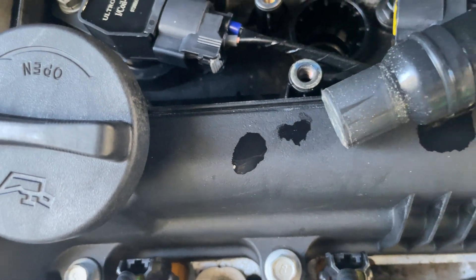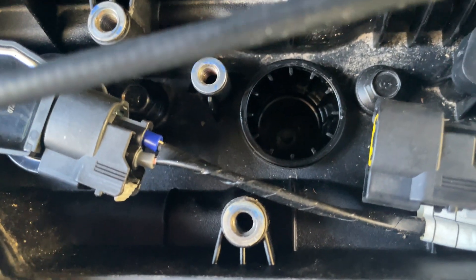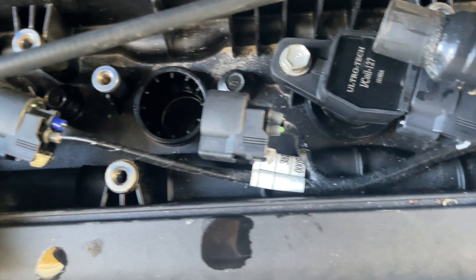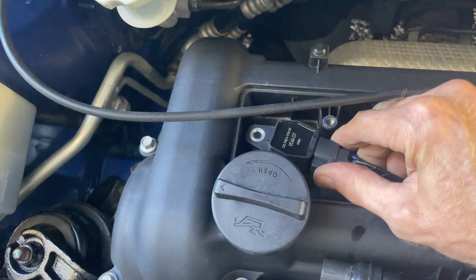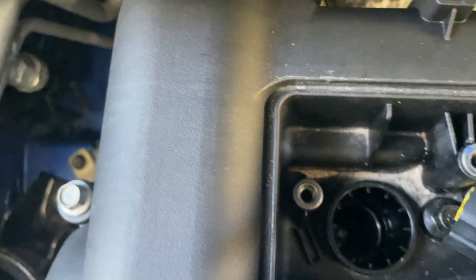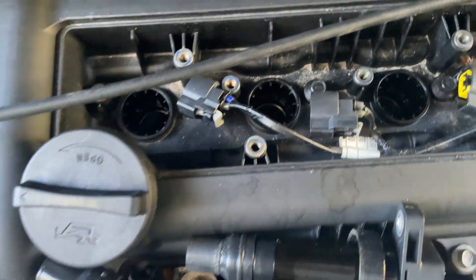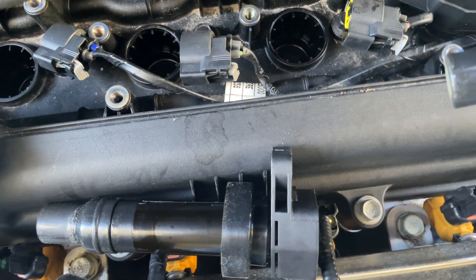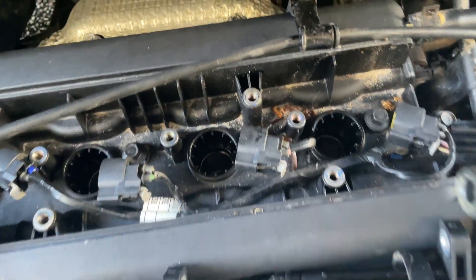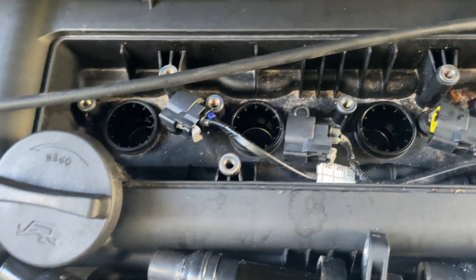When I pulled it out there's water in the bottom of the coil and a lot of water around the bottom of the spark plug. That will be shorting between the engine and the top of the plug if there's moisture in there - that's most probably the issue. Checking all the ports: number one's dry, number two's wet, number three has a little bit of moisture, number four looks dry. The only plug with major water is number two, and that's the one with the misfire. I think we found the problem.